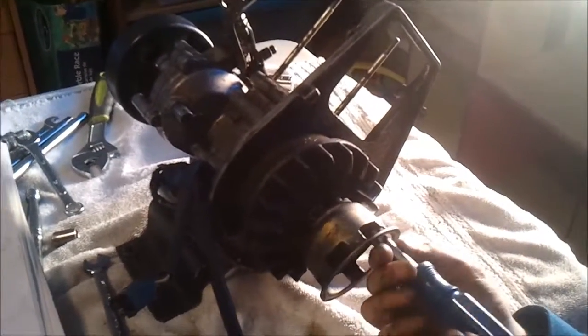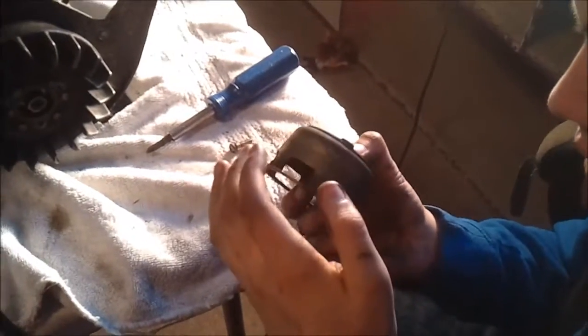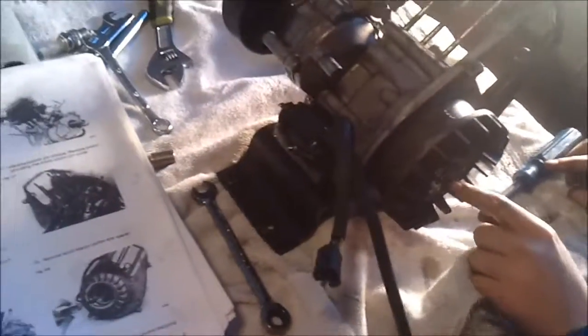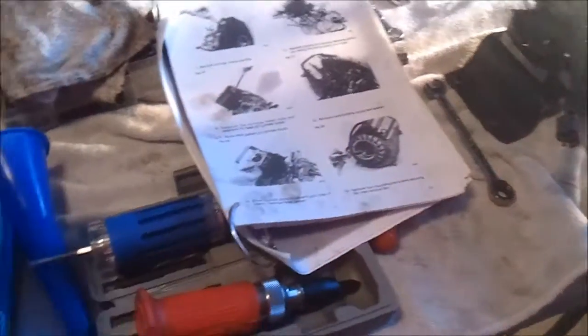These are lock washers? It's right there — oh, and you just go like that like no big deal. It's a lock washer, it's just squished. So it could probably use some new ones? That's not my point Zach — you're not going to have a good time putting it back together. Let's make sure of the orange head gasket orientation — it's raised on the back. We're videotaping it so we'll know. The raised part goes toward the engine, okay. And these go in the box.